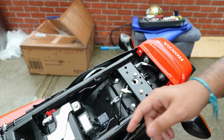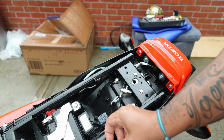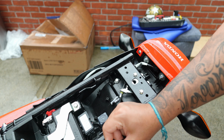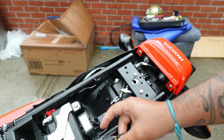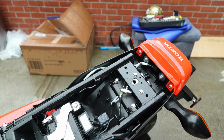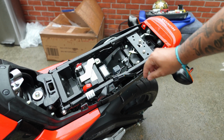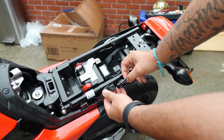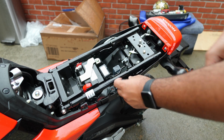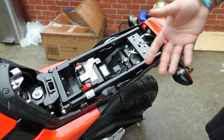So I think it's this one. I think. Oh man, what? How many are there? 2? There you go. You gotta hold both sides. They both got clips. It's not even showing. Let me move you guys back a little bit. Right here. It's right tucked in there. Just pull this out and unclip this. You still can push it through, but once you get those 4 bolts out, the whole tail will just drop down and you can remove it.